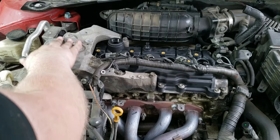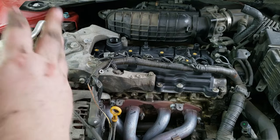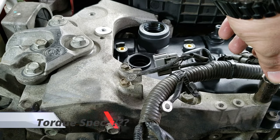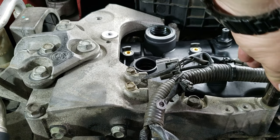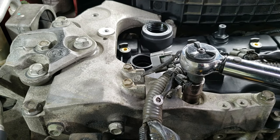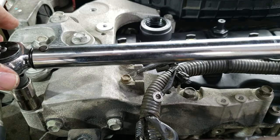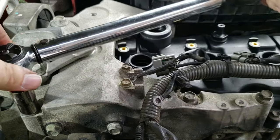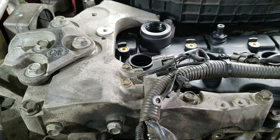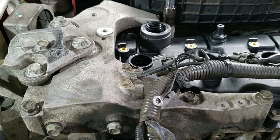Once you get these snug — you don't have to get them tightened all the way — once everything is snug, this should hold the engine up, so now you can lower the hydraulic jack. At this point, the five bolts that need to be put back on and tightened to the actual engine itself — I could not find the torque spec for these five bolts, so I would just say tighten it as much as you can. I ended up doing like 50 foot-pounds on my torque wrench. I scoured the internet and I could not find the torque specs, so if you happen to run into them leave a comment below — I'd greatly appreciate it and I can update the video.